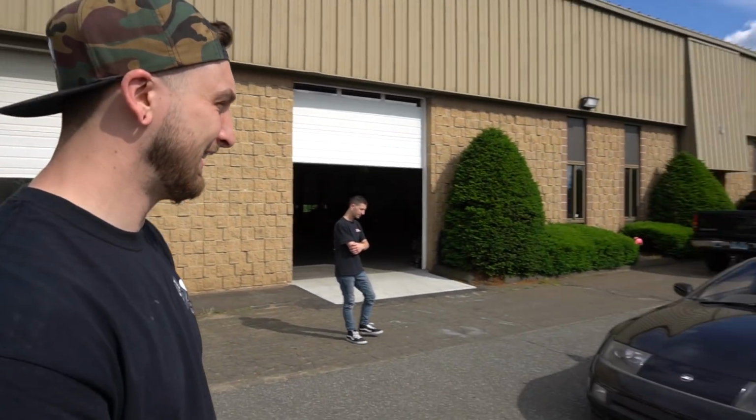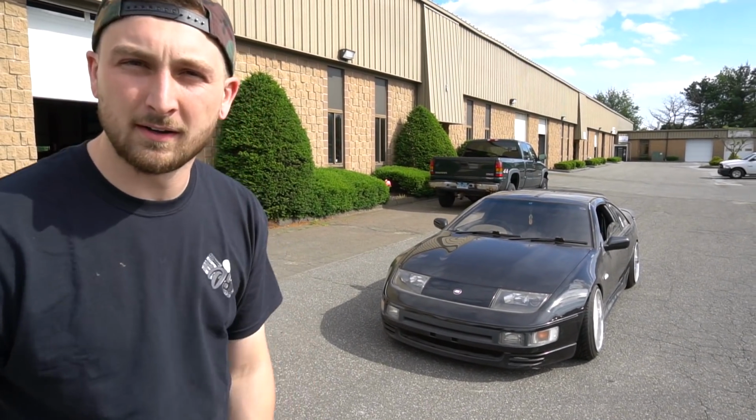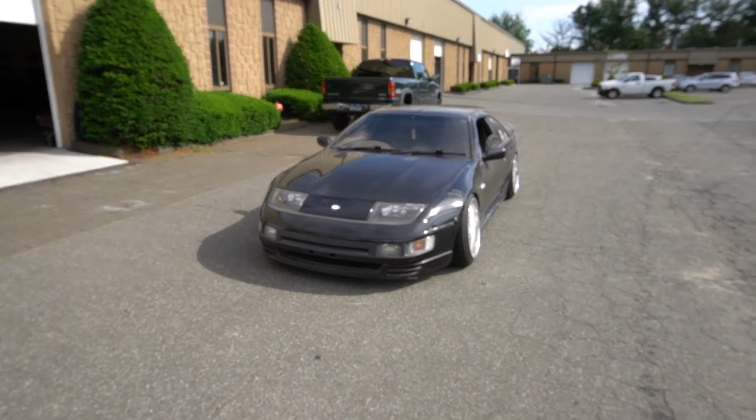It's so funny how, with the Link, I've had four different ECUs on this car, right? And it's crazy how much happier it is on the Link. It's ridiculous. They all do the same thing and control the same things, but I've barely touched this map so far. You saw it run around with no TPS, just did a little baby pull, and it's idling, no problem, no IAC. The throttle response is fantastic, which is hilarious. It feels like a whole different car, completely different. The only thing that's different is the management. I can't wait to tune this thing.